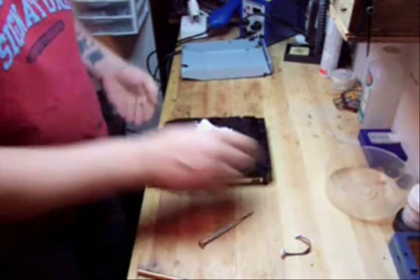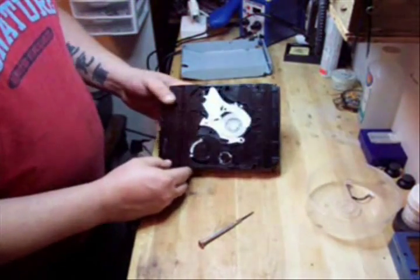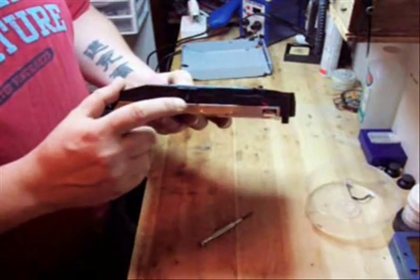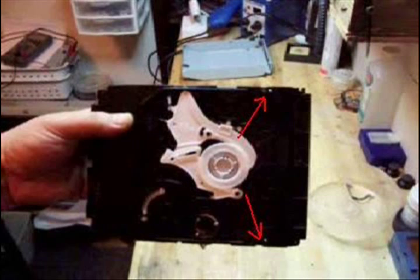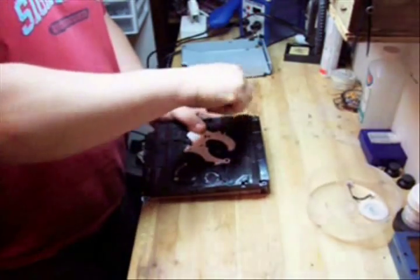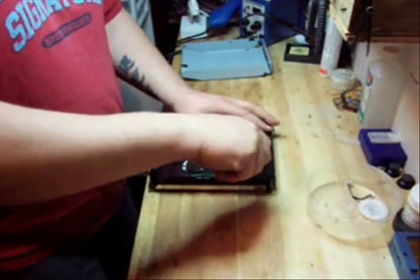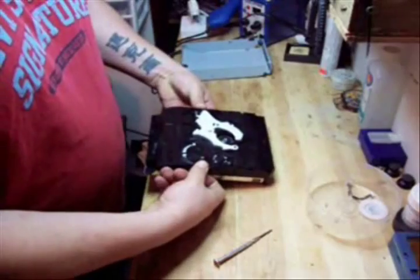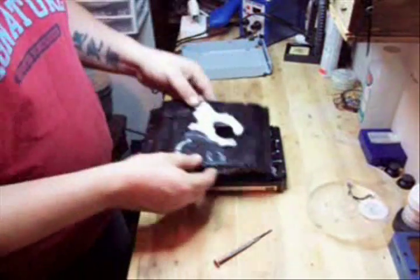Take the little screws that we pulled out and put them in a container, and the wire in a container. Now you're going to see that this Blu-ray drive has clips — there's one clip on each side. There are only two screws in the drive assembly. Take out the little magnet and put it to the side. Take out the two screws from the front, lift up on the two clips, and the drive comes ready to pop — no sensor wire on this drive. The top comes right off.